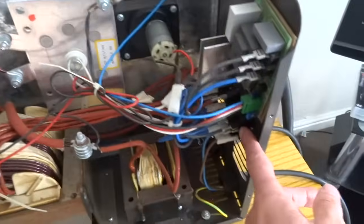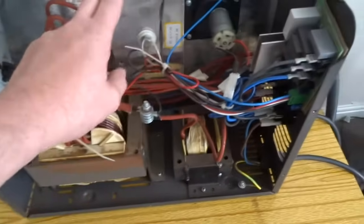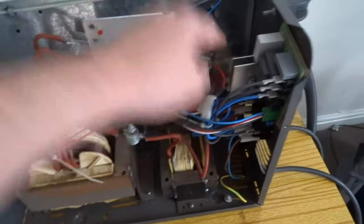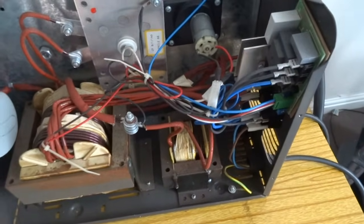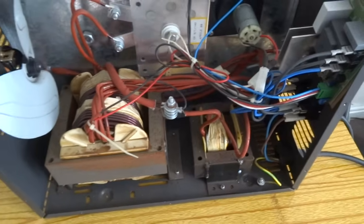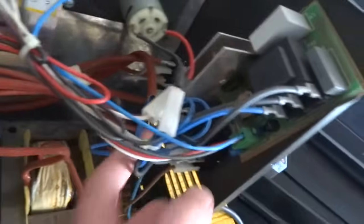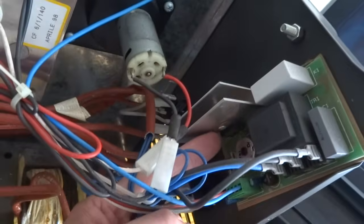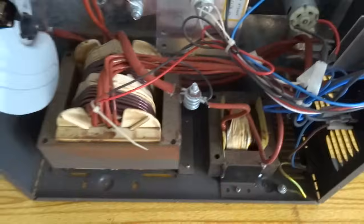So that's about it really. Main switches can go, thermal cutouts — though this one hasn't got one — diodes, your motor, your wire feed driving mechanism, and PCBs. The PCB usually has a transistor on it that burns out and needs replacing.